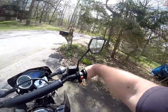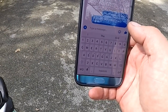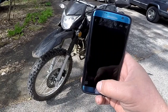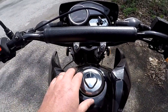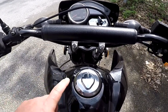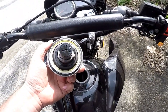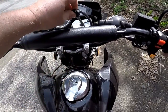Keep texting. He's sleeping — 10:30, V. Looks like no hawk time for V; he'd rather sleep. I actually had a couple of people saying that after they ride and they're going fast, it runs out of fuel and starts starving for fuel. I believe it's the little vent inside the gas cap. I told them to try loosening the gas cap and see if it comes back, because there's a little spring in there that's supposed to let air in as the fuel goes down so it doesn't create a vacuum lock.